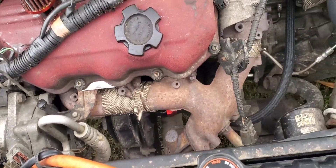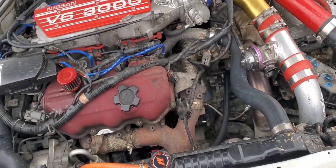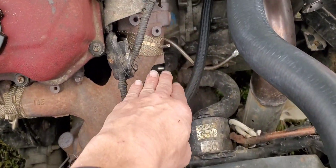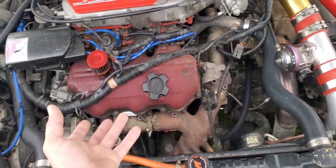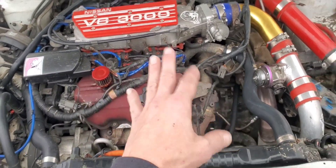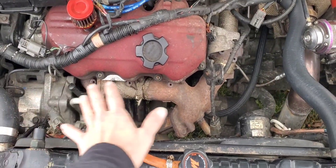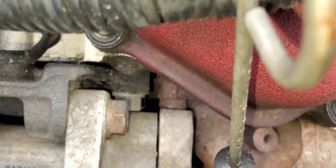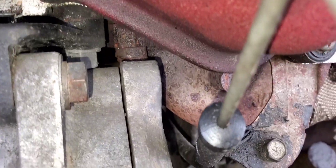So we're going to be fixing that. I got another manifold to put on, hopefully it won't push this pipe up too far because I'm using an S12 manifold flipped upside down. I'll show you that when we get there. We'll basically just be getting this stuff taken off — I'm pretty sure I have to take off the AC because there's a bolt literally right behind it.